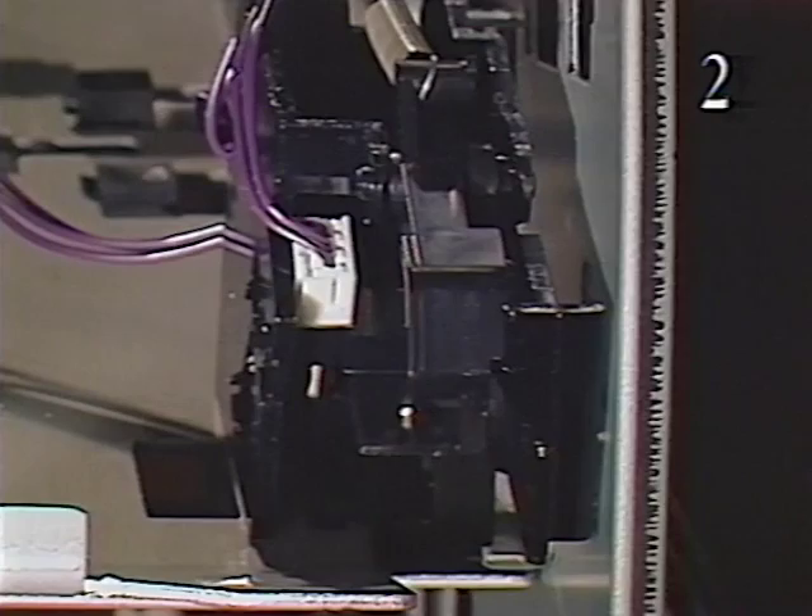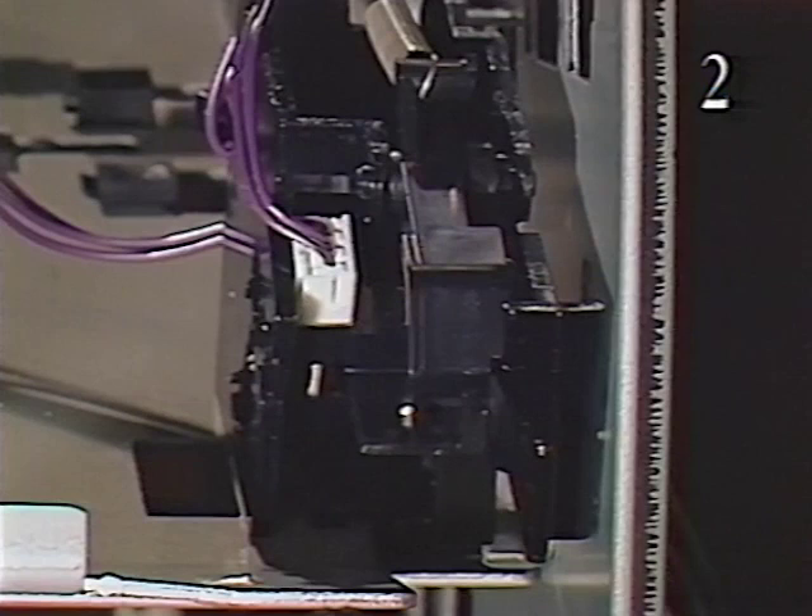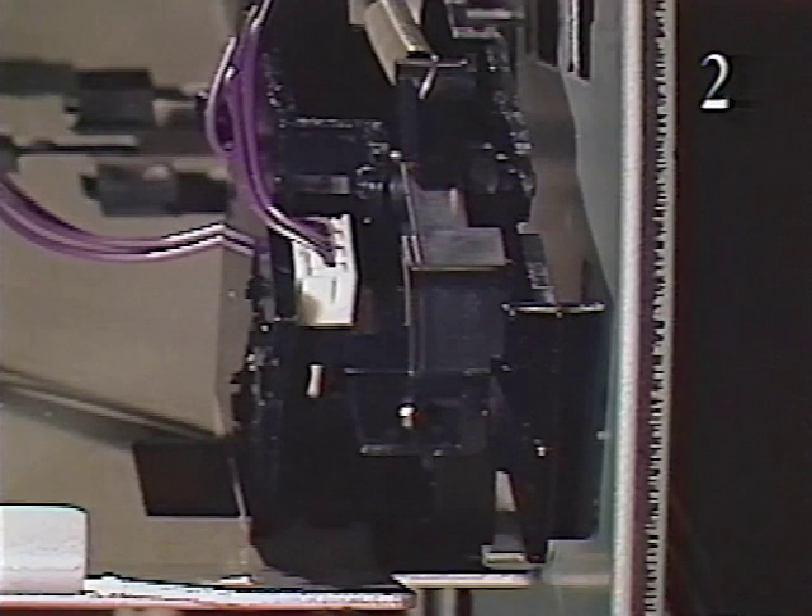Second, the upper sensor arm, when activated by opening the fuser access door, cuts off power. When the fuser access door is closed, the plastic tab on the door depresses the sensor arm, restoring power. This completes review of the print cycle and part two of the tape. Please stop the tape.